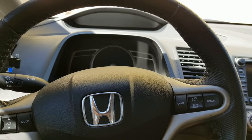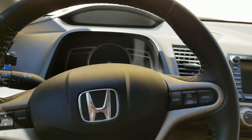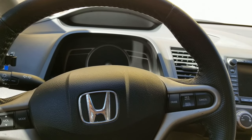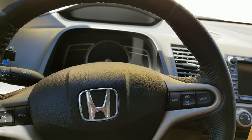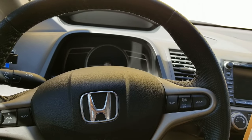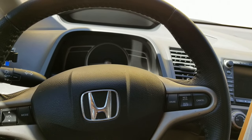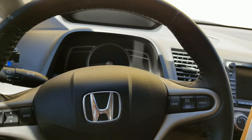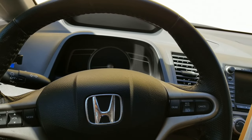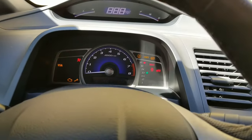We're going to monitor the ABS light on the dash. Press the brake down and hold it while you turn the ignition on — without starting the car — to the on position. The ABS will come on, and until you see the ABS light goes off, you will release the brake off the pedal. After that, the ABS light will come back on. Then press the brake down again and wait for the ABS light to go off, then release the brake again. The ABS light will blink twice, which will confirm the reset of your ABS light.